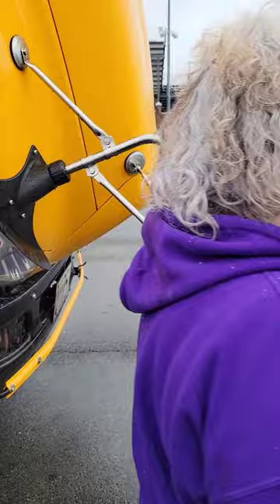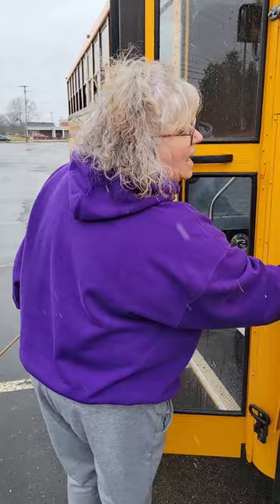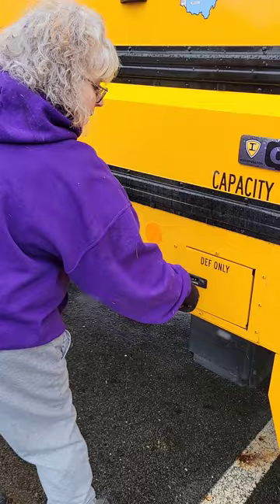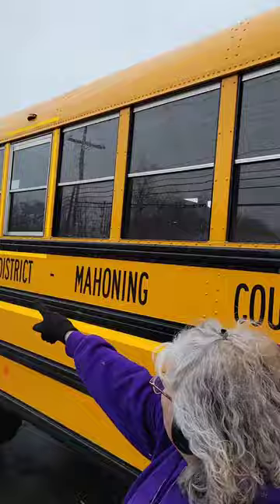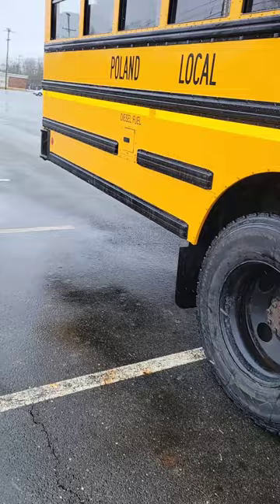Now I'm going to put my hood down. The next change in the pre-trip inspection is for a school bus — you need to inspect down the passenger side of the bus first. My hood latch is secure. My entrance light is secure to the bus, not broken or missing. Open my DEF door — my DEF tank is secure, not leaking, cap is tight. My amber turn signal four-way and my amber front, center, and red rear clearance lights are secure to the bus, not broken or missing. My reflective tape, including my amber front, center, and red rear circle reflectors, are not ripped or torn.